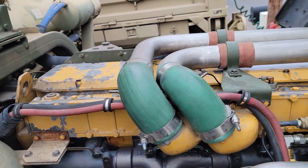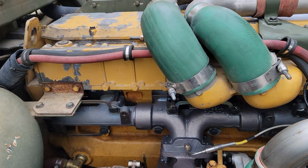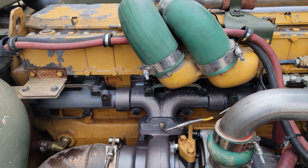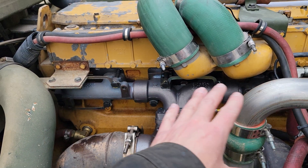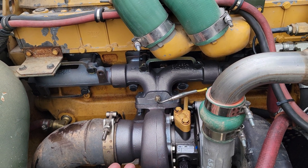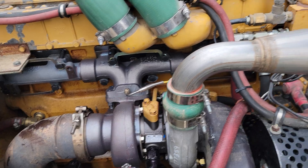As far as the test drive yesterday, is there a noticeable difference? Absolutely. The turbo spools up quicker, you get to boost a lot sooner, and you're getting an extra one or two pounds of boost just by swapping this turbo and going to an upgraded manifold. It's a higher-flowing, more updated turbo — easier to get parts for if something goes wrong — and it's not such a bottleneck in the entire system for this motor.